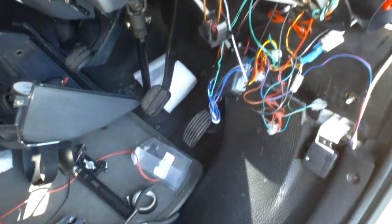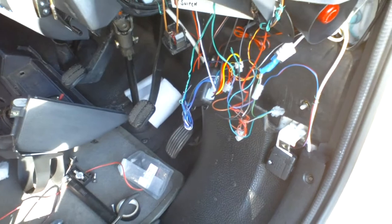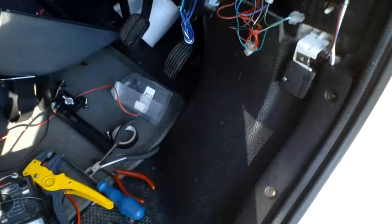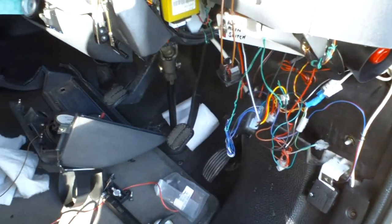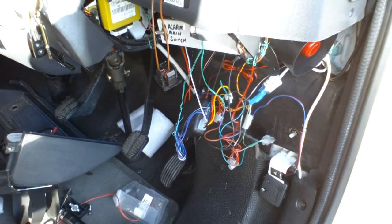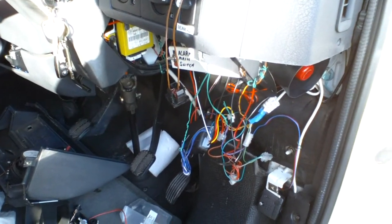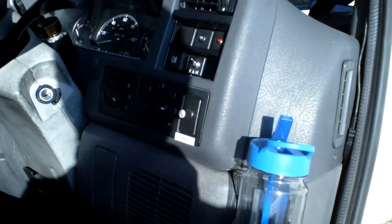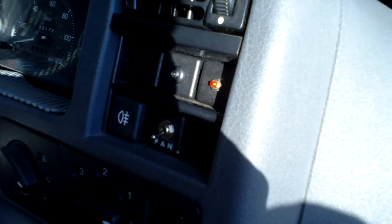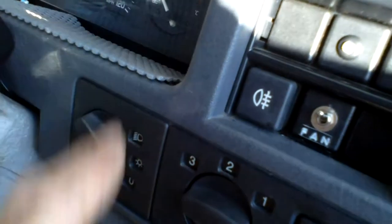It's amazing what you can do with just a bit of wire, a bulb, and a switch - you can identify if the relay is faulty, if the fan is still working with a multimeter, check you've got voltage, and check the coil to make sure that's working. So you can check if it's a relay fault, a fan fault, or a sender fault - all from that simple checking. So I can turn it on whenever I need to when the temperature goes up too much - listen to that, beautiful.